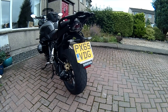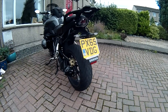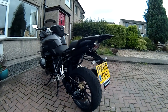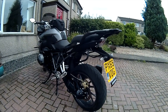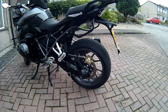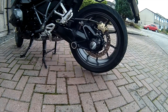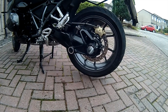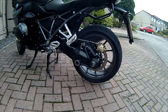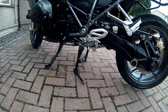The bike itself has been extremely reliable on the road. There have been two issues dealt with through the warranty. A while ago the rear suspension wasn't adjusting electronically — it turned out it was a strut itself that needed replacing and that was done. I had corrosion on the centre spool of the rear wheel because it hadn't been plated correctly, only about halfway through. It took two goes to get that replaced under warranty and a complete new rear axle has been fitted, so that's been sorted.